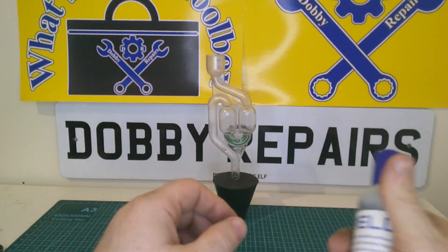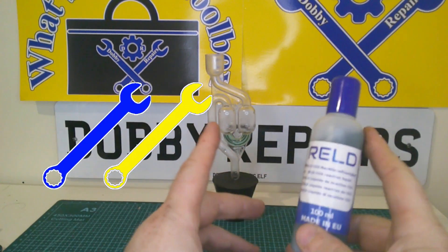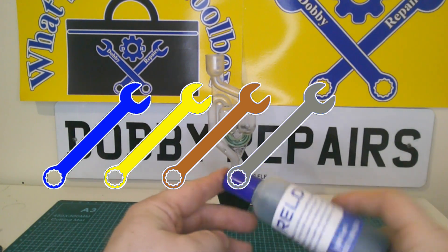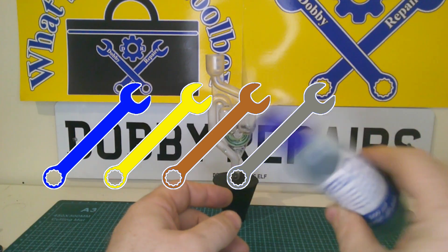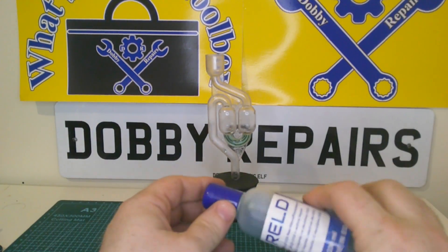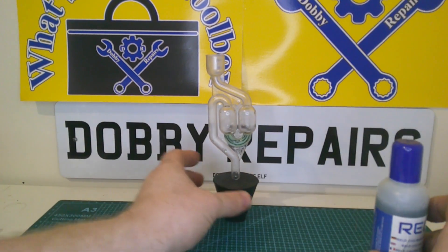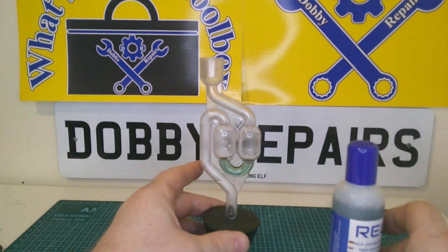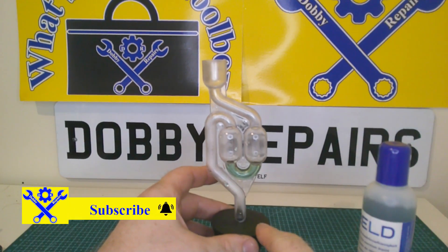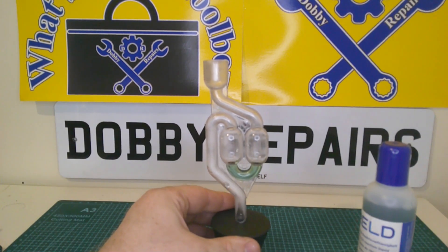Moving on to my final thoughts now — I really do like this. I'm going to give it a four spanner rating. It's very helpful and every time I've used it it's been 100% accurate. Every time I've used it I've either found a bad head gasket or confirmed I need to look somewhere else. Sometimes you can get murky water coming from another source, so it's helpful to rule things out. Like I said, four spanner rating — overall very handy. You can buy replacement fluid, it's good for testing, and cheap enough, so definitely a worthy addition to any diagnostic toolbox.